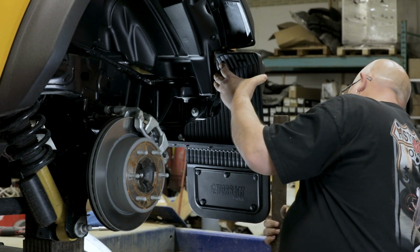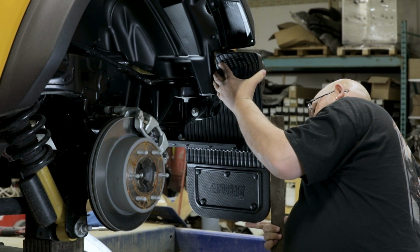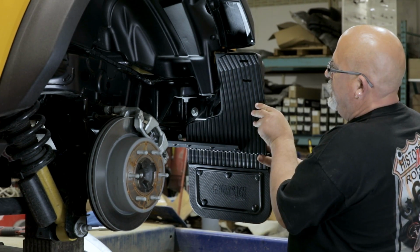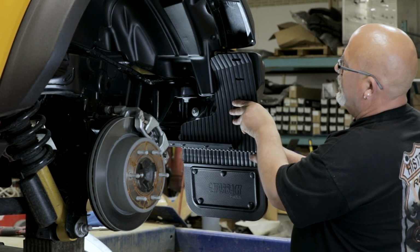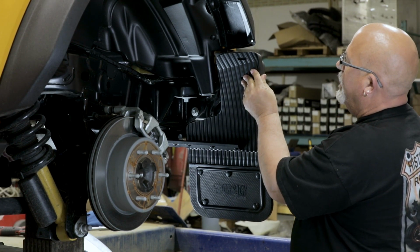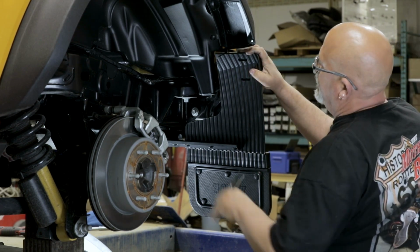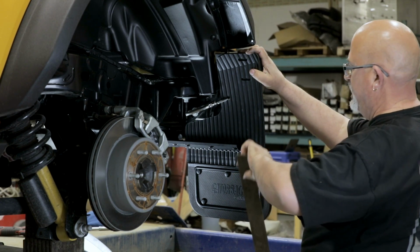With the flap in position, use a square or other leveling tool to make sure that the flap is level. This is a good time to choose how you want your flap to sit against the inside of the fender. You can slide your mud flap in and out by loosening the hardware on the mounting bracket, allowing you to match your mud flap's position to the Bronco's flare profile. We suggest you use a clamp to hold the flap in this level position for the following steps.